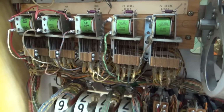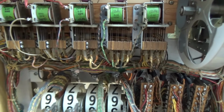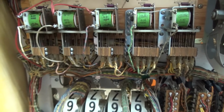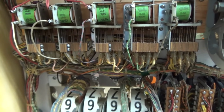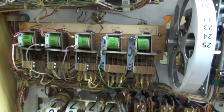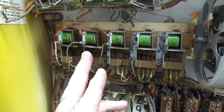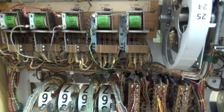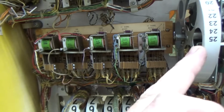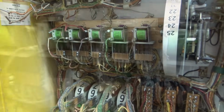There's one other type that's on a playfield sometimes, but you just need to make sure that they're all doing what they do. Now, don't adjust every switch in the game. You just want to adjust the ones that are obviously way off. If they look like, oh, this one's moving, but it's not moving as much as the one next to it, leave it alone. It doesn't matter. You don't have to adjust every switch. If it looks like they're touching but it's not moving, you might want to adjust that one. So I'm going to go through and clean those and make sure that they're adjusted right, and then we'll move on to something else. I like just getting those out of the way because they're easy to do.